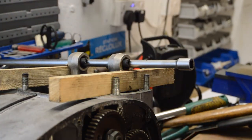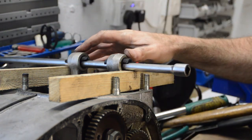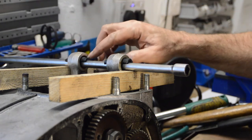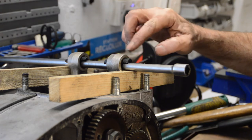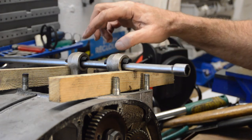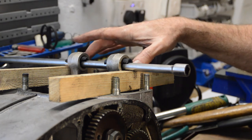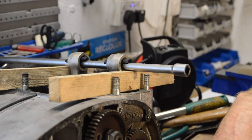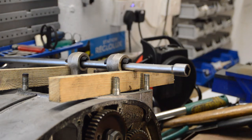Right, we'll move on to the pump nut. The workshop manual says to support the conrod eyes with a bar through them, which I've done. I've also added two rubber pieces made from old fuel line just to further protect the eyes. And then rest them on hardwood. Well, I didn't have any hardwood, just bits of ordinary wood. Because the pump nut is apparently very tight and also cack-handed. In other words, you've got to tighten it, as it were, to undo it, because the thread is reversed.